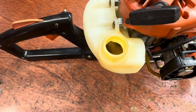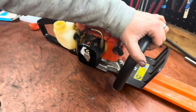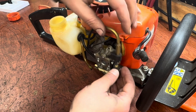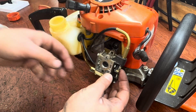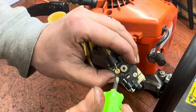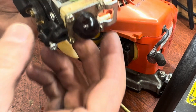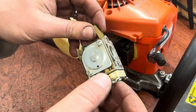You can also see down inside here the tank is pretty dirty — I'll have to clean that out as well. Let's jump right in and get this carburetor off. We're going to get these two screws off, set that to the side. We have our throttle linkage right here. We can pull the fuel lines off — they're just breaking at this point. We'll get the throttle off, turn it a little bit, pop that out and slide it through. There's our carburetor.